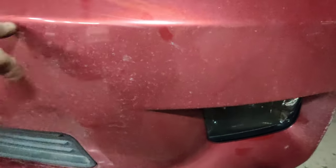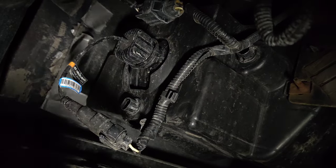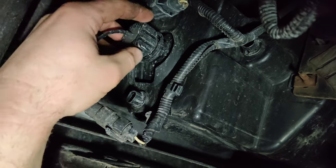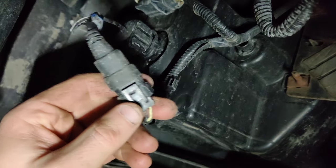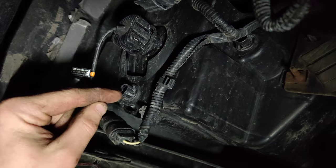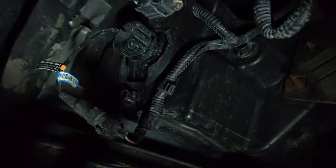Since I have the sport bumper I have to remove the bumper — I won't be able to get to it from the back. I'm underneath the truck now. This is the H11 LED — you just twist it and it pulls out. Here's the factory connector. There are three clip tabs: one here, a second one here, and the third one right here. You push them in and the fog light pops forward.